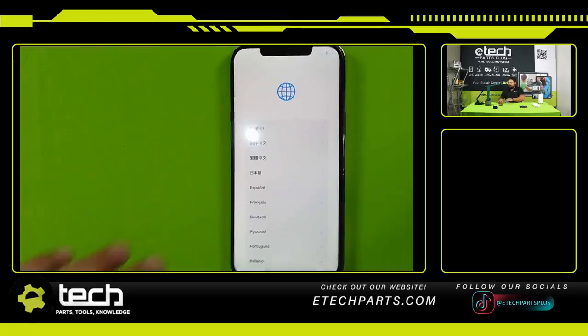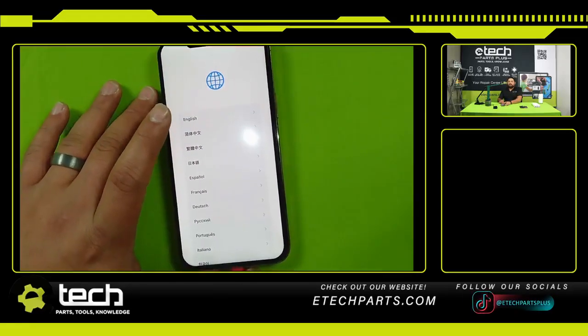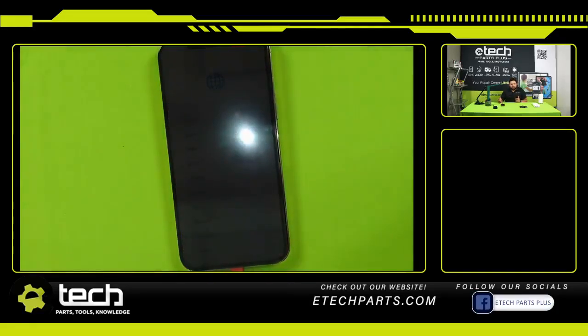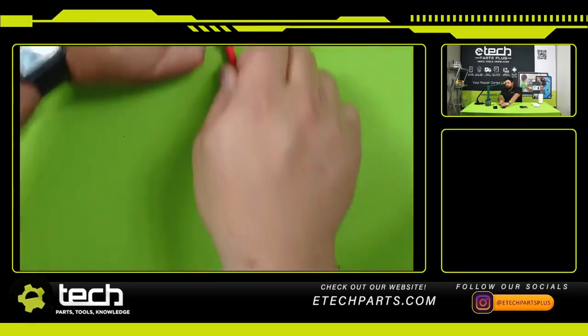The main scenario I've mentioned so far is if the cable is missing — if you don't plug it in when testing the phone. The second scenario is if the sensor flex is damaged. If it's damaged, it can cause the same issue, whether it's the proximity sensor part, the ambient light sensor, or just a tear in the cable. If it's damaged enough, it'll cause the phone to think it's not there, cause a short, not boot the phone up, or even boot loop on you. So that's important to check for.